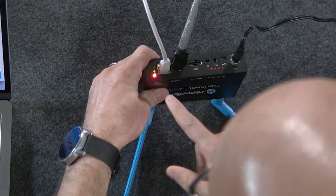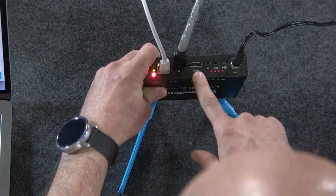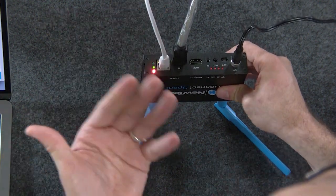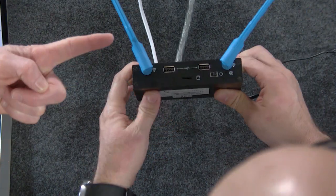So what's in this particular box? Right away we see this is the HDMI version, so we've got an HDMI loop out. We also have an audio input and loop out. Most importantly, we've got an ethernet jack because of course we're getting this on the network. But this one has one extra feature which I like, which is wireless. So we don't necessarily have to have the ethernet connection if the camera is remote or your source is not near the network, but it's near Wi-Fi — we've got the ability to extend that signal.